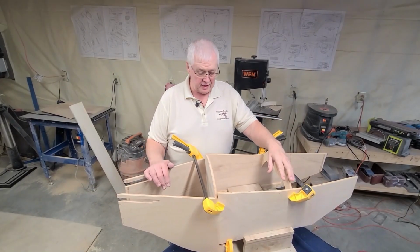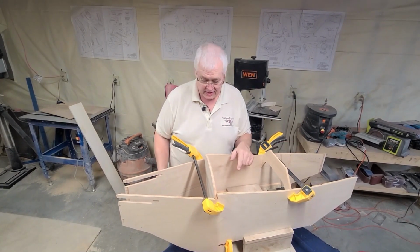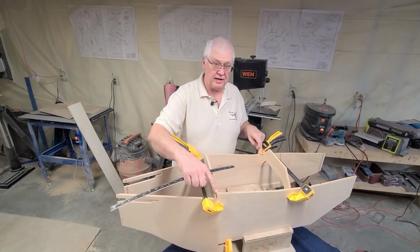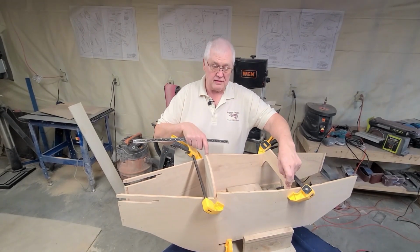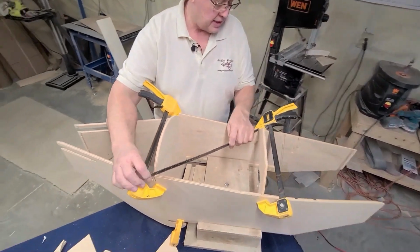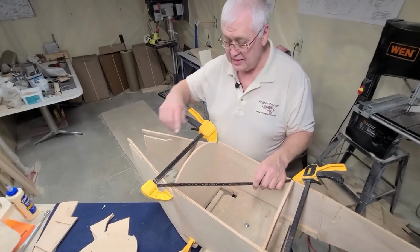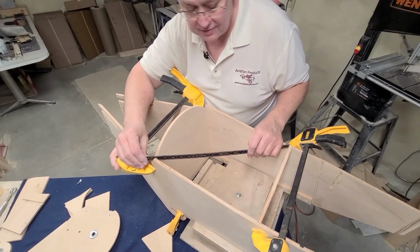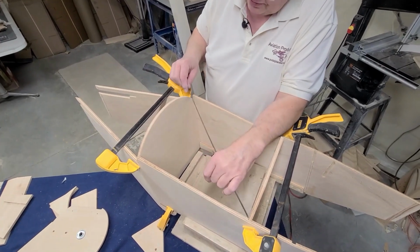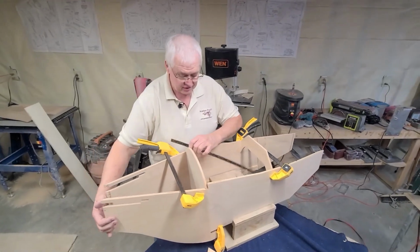Okay, we just got the instrument panel in and the seat back installed temporarily right now. Just clamp them into place. What you need to do is go from this corner to this corner and measure whatever it is. And this corner to here, make these two measurements the same. On 99% of the Mustangs that I build, this dimension is 17.8 inches. So I measure there to there, and that one's 18.1, and this one's going to be 17.4. So we got to move this side forward.